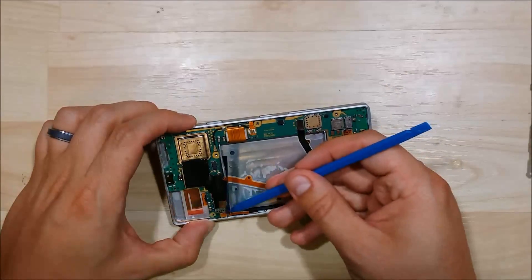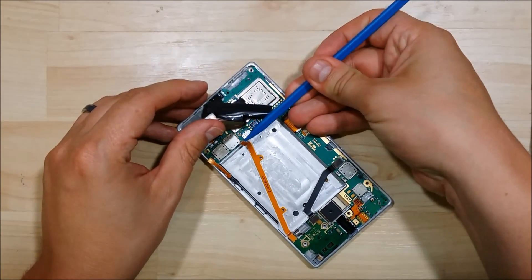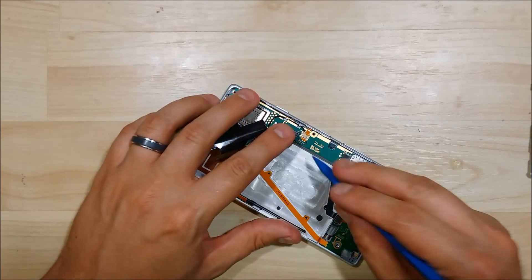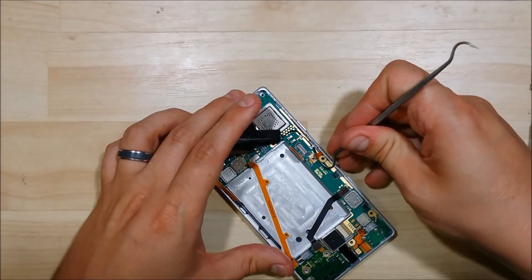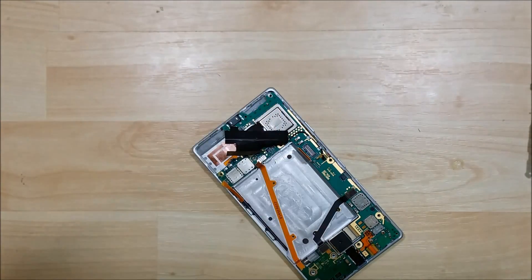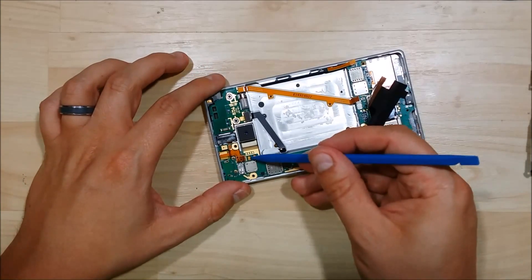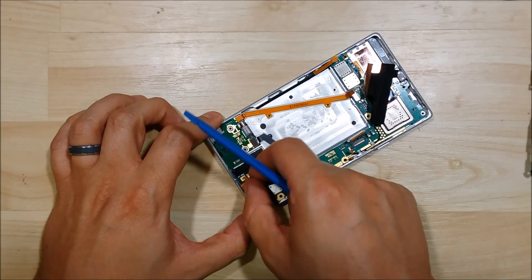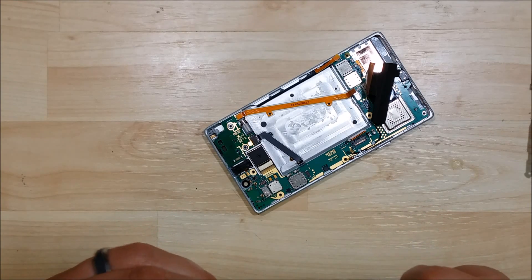You can see there are a couple cables that run across underneath — it's almost kind of like an HTC phone; they've got cables running every which way in here. I'm disconnecting two cables here: one was for the side slot and one goes across the middle. There's an LCD cable right here we'll go ahead and undo. We have a funky wire connector here as well — pop that off. It's got a ribbon cable on top that's actually stuck down with some adhesive onto the logic board, so we're going to pry that back with the dental pick. We'll pop off this cable connector here as well. There's one for the front facing camera right here — we can actually go ahead and remove the front facing camera once we undo that cable connector. There's a little foam housing around the camera — go ahead and put that back in and make sure it's lined up correctly so you don't lose it.